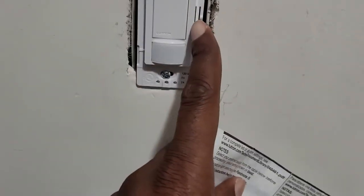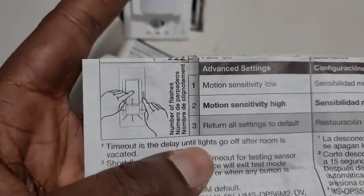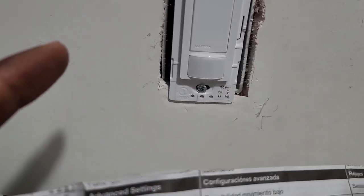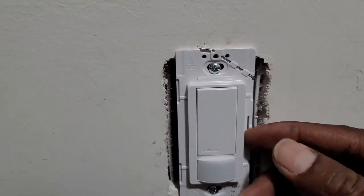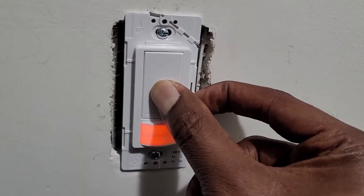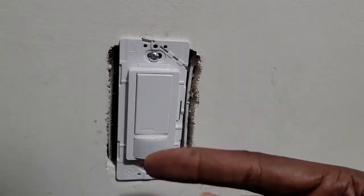The last setting is motion sensor sensitivity. You have to hold down both buttons simultaneously - the big one and that little one at the same time. I put the back of my nail on one and hold with my thumb, holding both together. That sets the sensitivity to low. If you want to reset everything, press both buttons together three times and it resets all settings.